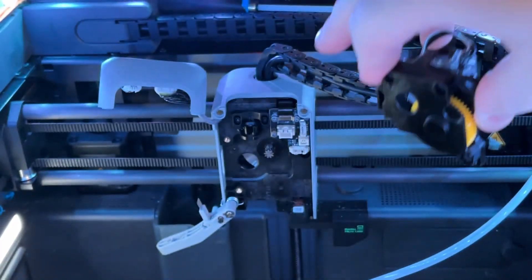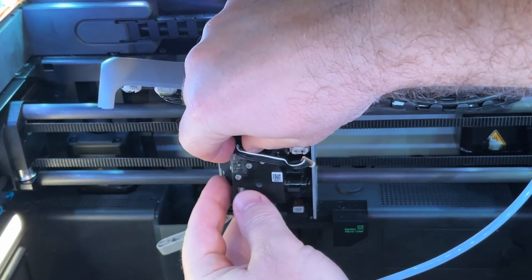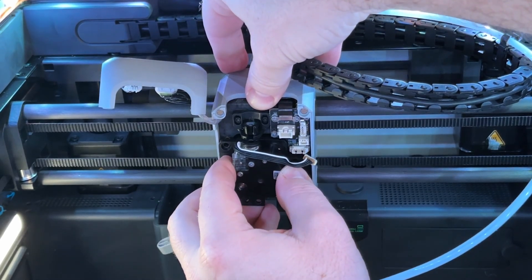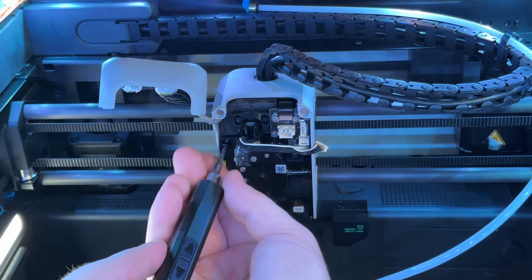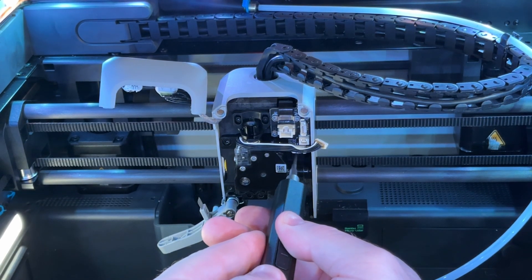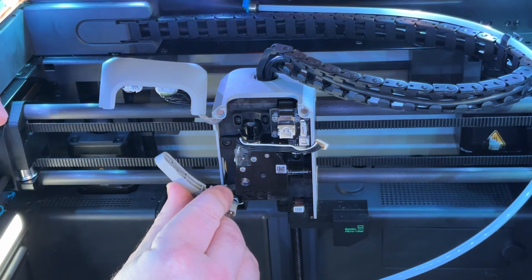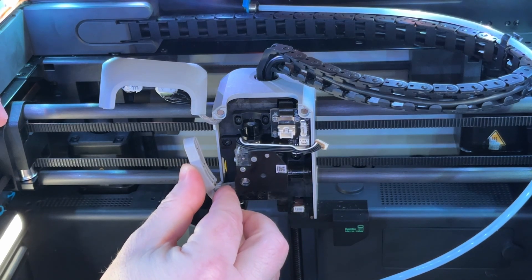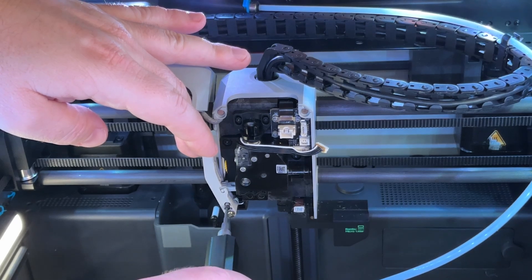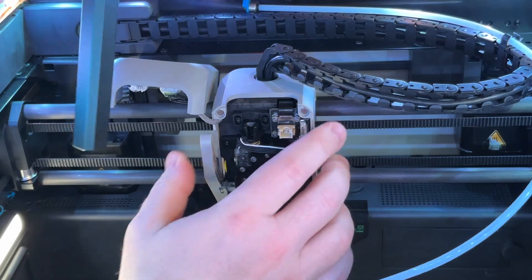For the next step we need to assemble it back into the tool head. Align the internal gear to the motor gear on the tool head, make sure it's in the correct orientation, and it should just push back in place — simply wriggle it around a bit until it fits. We can then put in our screws for the top, the middle, and the bottom. Then align the filament cutter into the little slot, and while holding it in place, tighten the screw back up. With the screw engaged it will prevent the cutter from falling away — it's a good idea to test that the movement is there.